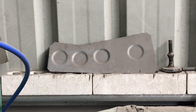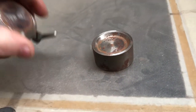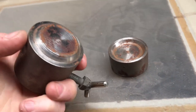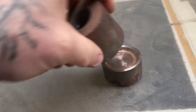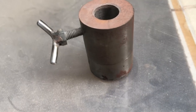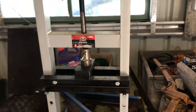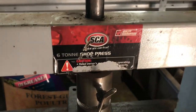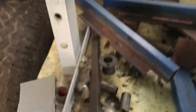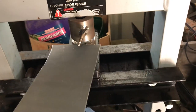Those little circles there — there's another press I made for a job a while ago. It's just a bit of round bar — essentially a dimple die that doesn't have a hole in it. It goes in the same way, locks onto the press and pushes the circles in. This is the little press. It's small and only six ton, but for the little jobs I use it for like pressing out bushes, it's really good. I think it was about $99.